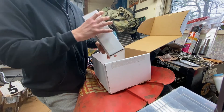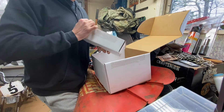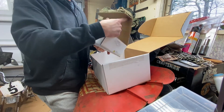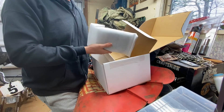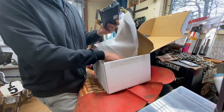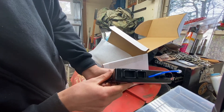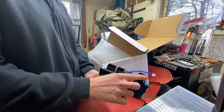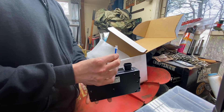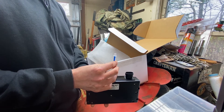So we're opening up our ECU now. I think it opens from the top. So here's our ECU — we got our two plugs. We got our power; one's the injector plug and the other one's for all our sensors. This is that MAP sensor I was talking about — MAP stands for manifold absolute pressure. It's pretty much vacuum — it's going to measure the vacuum and know what your engine is doing under load by using vacuum, and it tables by that.